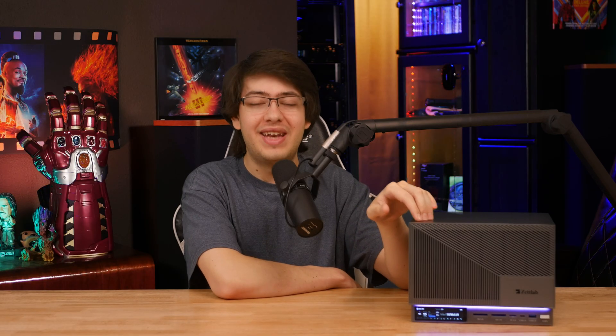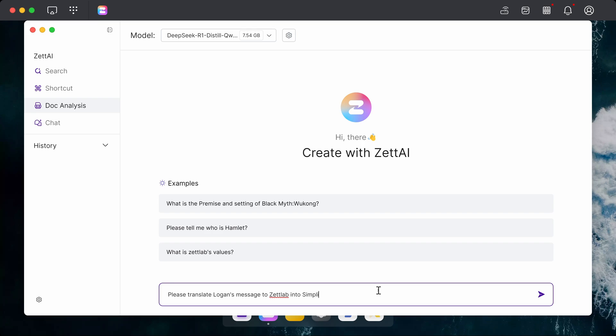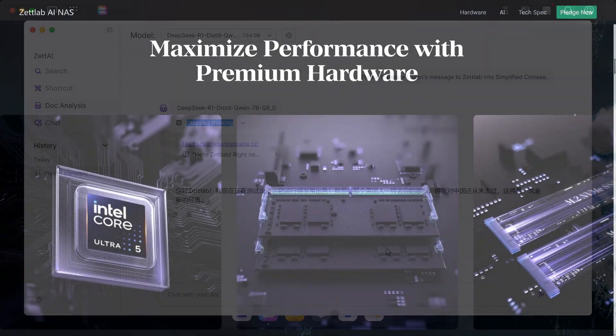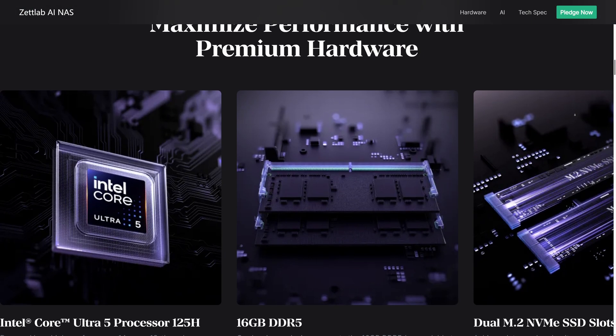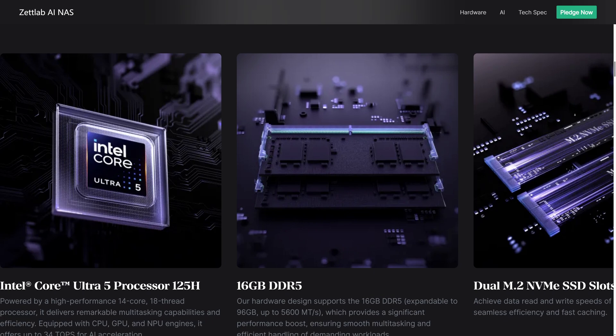If you really have a lot of data to keep track of, I could see why this would be a useful feature. But there are a couple of caveats with this on the D4 and D6 models specifically — the AI chat and document scanning features don't actually run on the NAS. Instead, you're supposed to download their desktop software, and then it's going to run on your CPU, or hopefully later on your GPU if you have a compatible card, using data from the NAS along with data from the LLM you're running on your machine. But if you want these LLMs to run on the NAS itself, you're going to have to upgrade to the D6 Ultra or D8 Ultra, which are both equipped with a much faster Core 5 Ultra 125H, and those are actually capable of running these LLM models directly on the NAS.